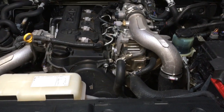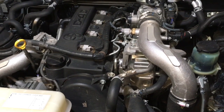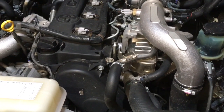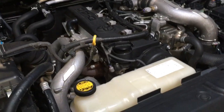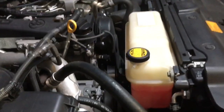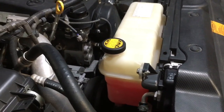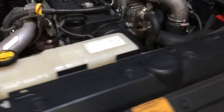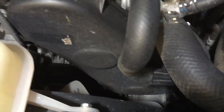It is pretty straightforward. I'm not sure if we've got a detailed video in the VIP group or not, but just wanted to quickly run through a few basics — not really how to do the belt, more so what we recommend. At 160k the coolant's due also, so it would be wise to combine the timing belt and the coolant replacement job together. That way you can drop the coolant tank and fan shroud out of the way and give yourself a lot more room to get into the timing belt. To do just the timing belt with that coolant tank there is the hard way.